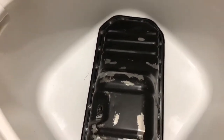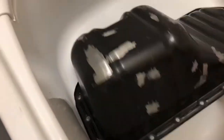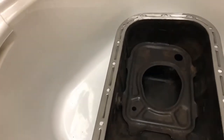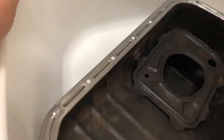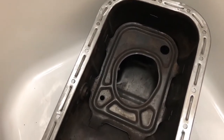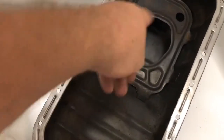I've spent probably the last hour working on the sump. Anywhere there was any rust spots, I've cleaned those up. Thanks to Scott's advice, I was able to get off all this gunk — the old silicone. I just wasn't too sure how hard I could go at it having not done it before. It turned out really nice. I went over it with a small wire brush to get in all the grooves, and then went along with a little sanding drum on my Dremel to clean up the surface and get any jagged edges off. Now I'm going to go over it with some hot soapy water, get out any gunk or metal filings, give the outside a good clean up, then mask up and undercoat it.